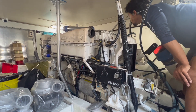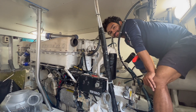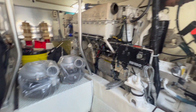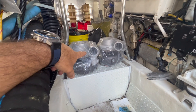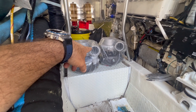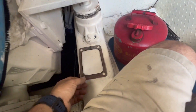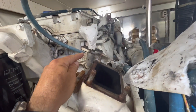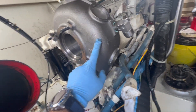We also have to remember how we took these things apart - it was a long time ago. We can reference our videos, god I hope we did it right. The turbos we had to split - everything is put together for us so the only thing we'll really have to do is rotate the housing to accommodate the intake. We've already taken off the old gaskets, we have two new gaskets, and I even bought new gaskets for the oil.